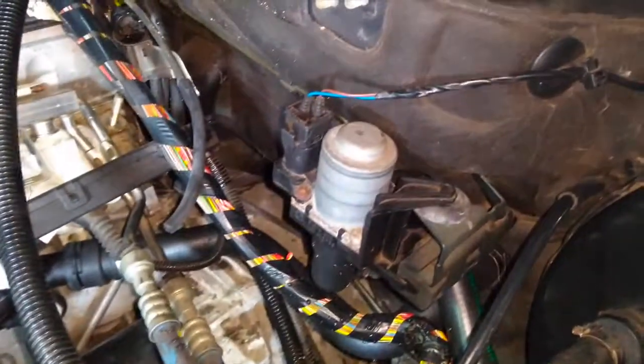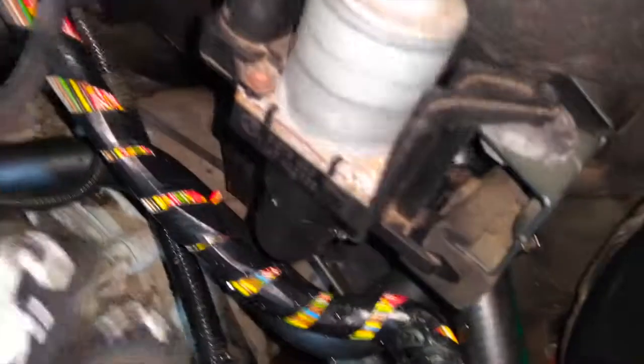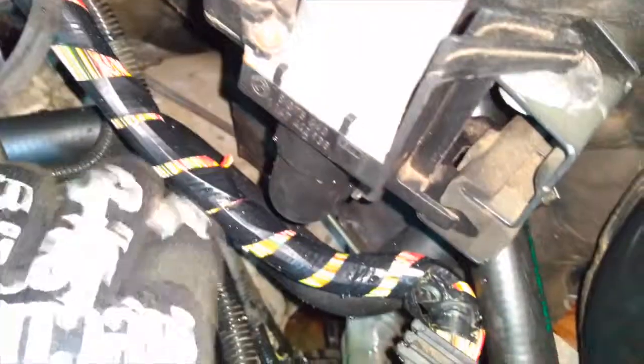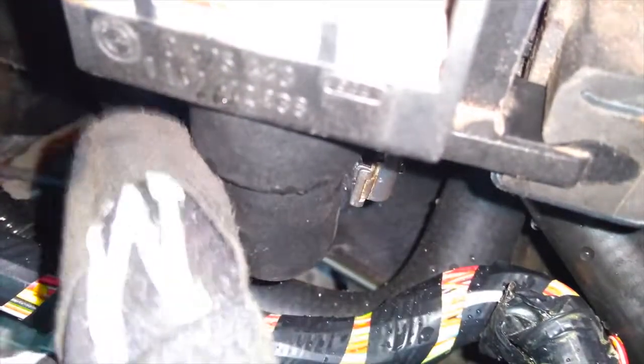I'm glad I did that pressure test, because we had a nice little jet of water come right out of here, out of the bottom. You can see there's some water on the components. This is the water valve to the heater core, and it just spurred a leak down here at this connection. I'm hoping it's just as simple as tightening this up and not something more serious. It got up to about 10 pounds before this actually gave out. So I'm going to try this again.